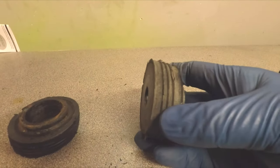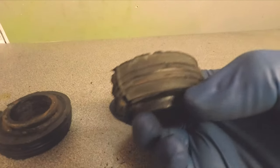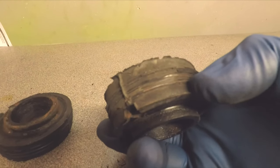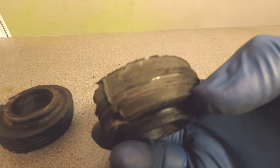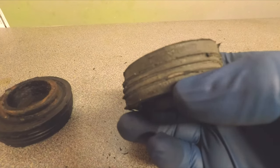So this was the right-side swingarm bushing — didn't look too bad. Now this is the left-side swingarm bushing, and this one has some damage to it. Right here — it's metal on metal. I think you can see that on the camera. Yeah, it was a little worn out — this one here was hitting metal on metal as well. So there you have it, those are the two old ones — right in the trash.